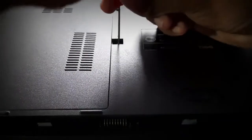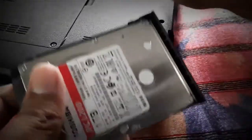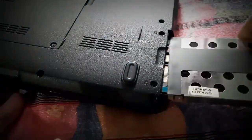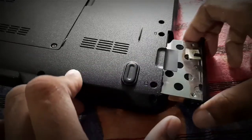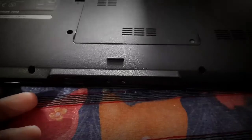Place your CD-ROM drive back in place, just push it and tighten it with the screw provided. Now the CD-ROM is also in the right place. After that, put the hard drive back in — for you it may be different so figure a way out. If you have a new laptop you don't need to do any of these things. Just slide it in like this and put the two screws on. Now it's time for placing the battery back — just slide it in like this, and everything is done. Our laptop is set to go.